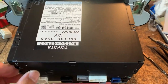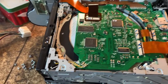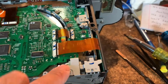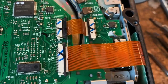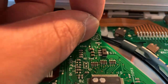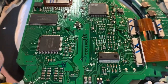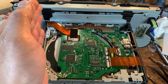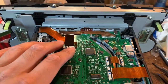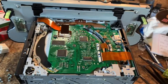Once you remove the screws, this top panel actually just slides out fairly easily. You can look inside — the CD changer is right on top; it's a four-disc changer stacked on top here. What you have to do is remove these ribbon cables, and then there's actually a screw right here that I've already removed. Then we bend down these tabs — there's another tab right here, bend that tab over — and this board flips open like this. That's all we have to do to get the CDs out. Be careful of this ribbon cable; it's a very important ribbon cable that connects to the motherboard of the unit.